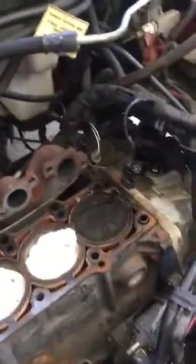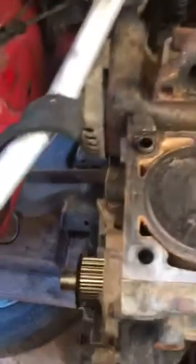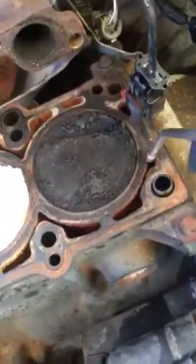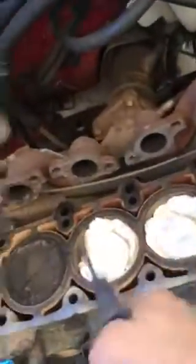How do we get all that crap stuff out of there? You can put a funnel in here. What I will do is rotate the engine and put all the pistons to meet in the middle, and then cover them all up with a nice towel. Then I can put a long funnel in there, stick it in there, and start pouring water — it's going to come right through there. This is where the water pump goes. I'll show you my little air tool — put it in there. It's going to be flying up and stuff, but your cylinders are covered so you're safe.